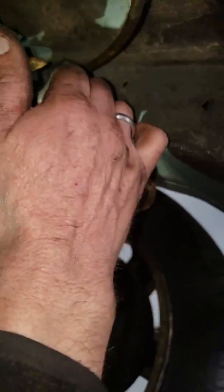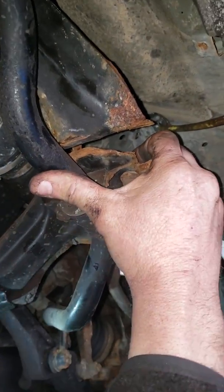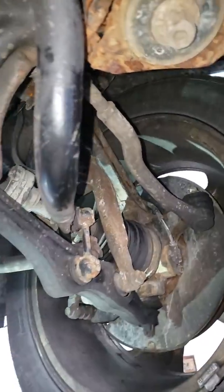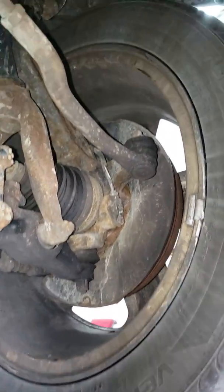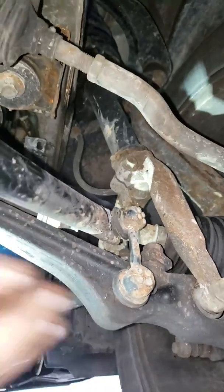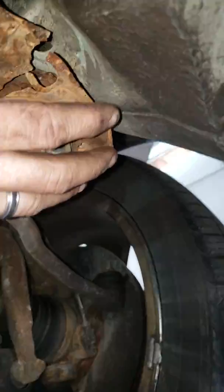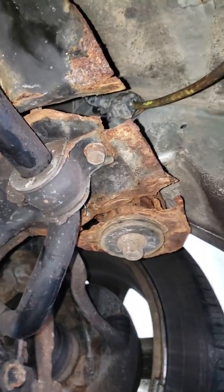That's what you're hearing while you're going down the road — this is a sway bar and it flexes, causing that to scratch on that other piece. What I was worried about is something here because I've seen actual wheels just fold out. Well, this is your lower control arm and it's bolted up here. This whole corner has been compromised for the structure of this thing. So it just has to be replaced. There's just no doubt about it.